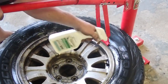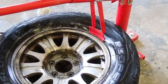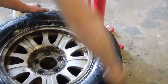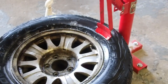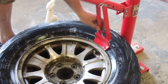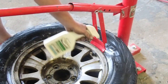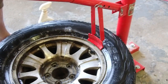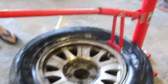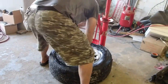I turned it and moved that bead a little bit. Walk this shoe in so that it's now on the bead. Give it some lube. Give it a little pressure and make sure you keep this straight when you're giving pressure. You can see that did move the bead because that shoe didn't get stuck. Make sure your tire is seated well with the bead on that shoe. And there you go — without breaking it.